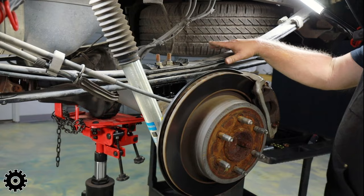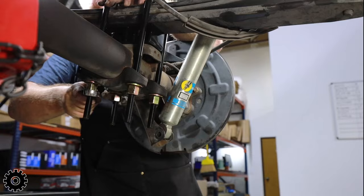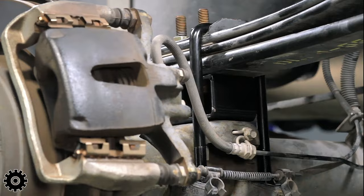Make sure your bolt holes are lined up, and then you put longer U-bolts — it does require longer clamping U-bolts to hold the assembly together. We just call them lift blocks and U-bolts. It doesn't take much time; you could do it in your backyard or driveway.